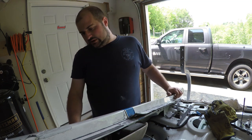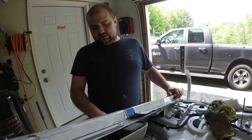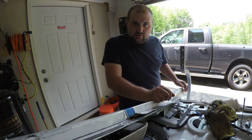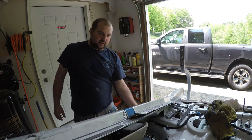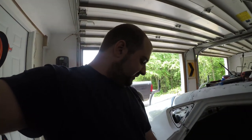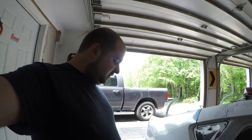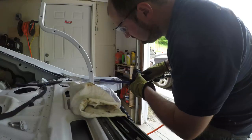on these spot welds over here where the quarter panel glass went, and could probably continue down this backside and get these spot welds released, working our way over and under the car until we get to the wheel well, and that's where we'll have to change directions. We also need to come over here to the door jamb and grind all the spot welds out over there. So hopefully this quarter panel should be on its way to coming off.